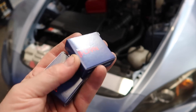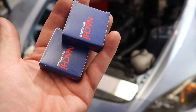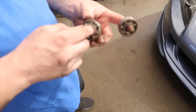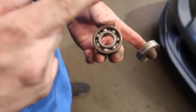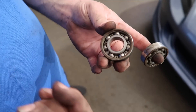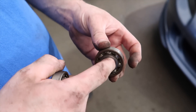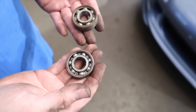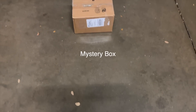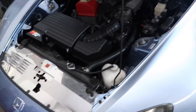I mentioned how many of these we sell — I think four sets are going out today alone. So this is set number five. You never know what's wrong with your pulley bearings. This one here has no grease in it — the no grease is going to go metal on metal and wear out the bearing. This one still has grease but has play in the center. All the grease has been flung out of it. So we have them in the store, guys — go ahead and check it out.